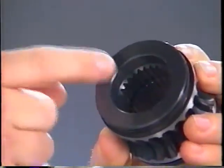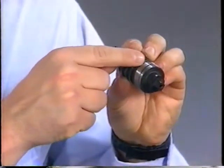A grease groove and holes added to the ASA gear splines improve lubrication and prevent corrosion and wear of ASA and camshaft splines. This makes it easier to remove the ASA if required. Now, this will be on all slacks except for the ones with 10 spline gears. A spiral groove added to the worm shaft journal improves lubrication and prevents corrosion.